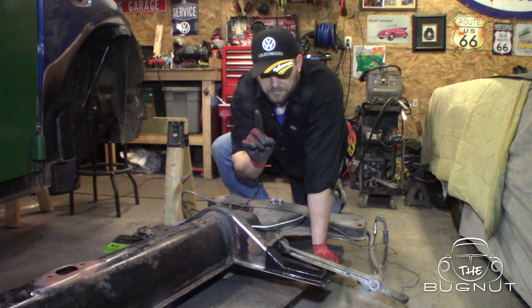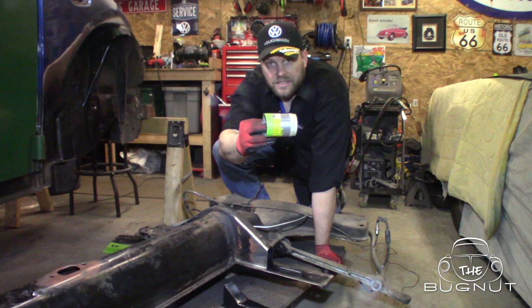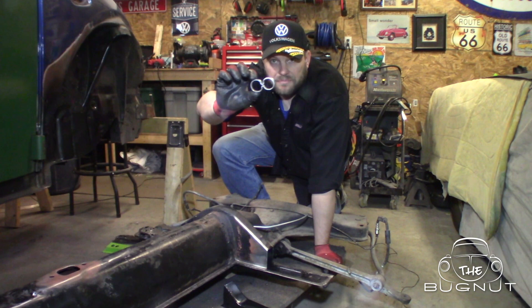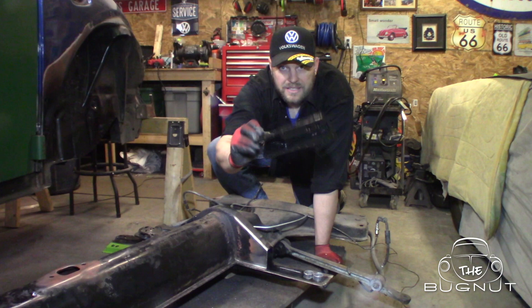We'll be able to go in, clean this up just a little bit more, and weld this all in — but before we do that we had to make one more piece you don't want to forget about. This is just a piece that goes inside so that when you crank those bolts down tight to the body of the car you don't crush anything. You need another piece of metal — I made this one by slicing off a piece of exhaust pipe to the right thickness, then using some pliers to bend it into the shape we need, which is basically a peanut or figure eight. That will go over with a bolt, and then your new replacement piece will go over top of that.